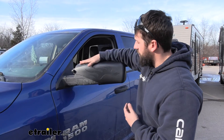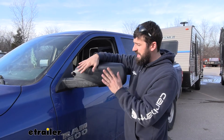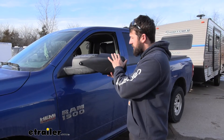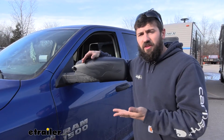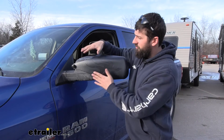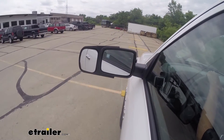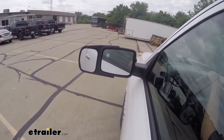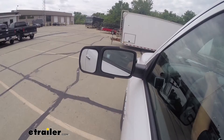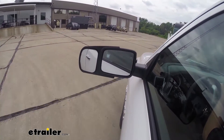So here's what our towing mirrors look like installed. These are a custom fit, meaning the inside is molded to match the outer shape of our factory mirrors, which makes for a very seamless fit. With the custom fit it's going to be much tighter than a set of universal mirrors, and the reason that's important is the tighter your fit of your towing mirror on your factory mirror, the less distortion you're going to have — and the less distortion you have, the greater visibility you have. A lot of times with universal clamp-on towing mirrors you get a lot of rattle going down the road, and that rattle is going to distort your vision. So having a nice tight custom fit mirror is definitely an asset.